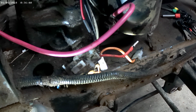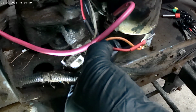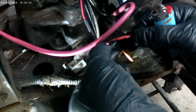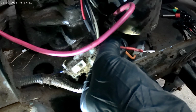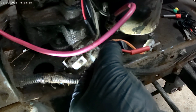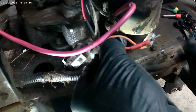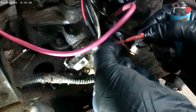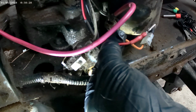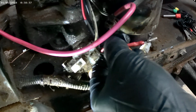And then take a lighter or a heat gun, preferably, but I'm going to use a lighter and just kind of, you don't have to hold it on it, just get a little heat to it and let it shrink up. Just like that. I got a bigger piece. Just slip right over that piece. And I do the same thing. Just put a little heat to it. You don't have to go be crazy with it. Get it too hot and it wants to burn it. That looks good. And then it is tight as can be and good to go.